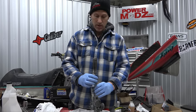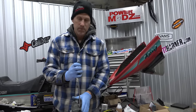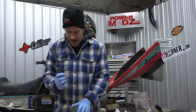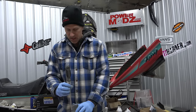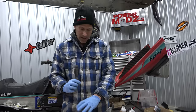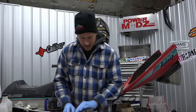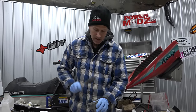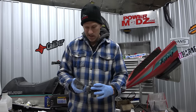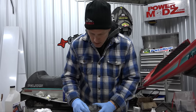When you're done cleaning these, you've got to use compressed air to blow everything out. If you don't use compressed air it's not going to work - telling you right now. You're gonna have water or something in those passages. When the air starts flowing through there really fast, water will freeze up, things will frost up, passages will get blocked - it'll run boggy. Just even looking through these carbs, I can see right through the pilot jet. Still super duper clean - I don't even think I ran this after I rebuilt these last year.